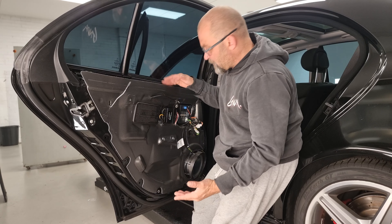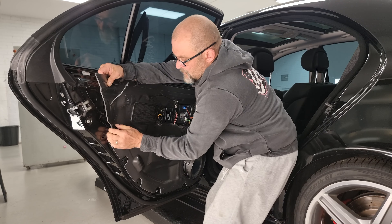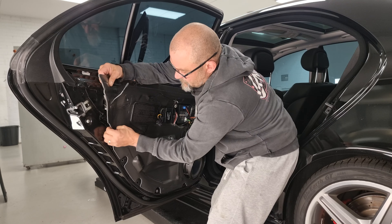So now the trim is off. I'm going to remove this cover here - it's not very hard. Just get your fingers in behind it and just separate it. Whatever you do, just be aware these cars are obviously getting a bit old now, so be very careful and just try not to tear it. Work it away. You'll see the little locking button here - if you pull up, lay it down and just pull straight out, then that way you won't do any damage.